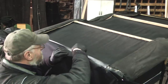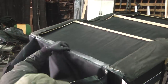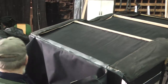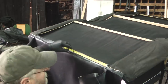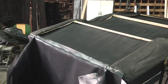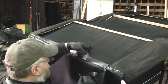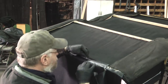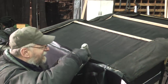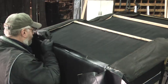With the curtain in position I'm going to roll the top back, kind of open up where I had some of this adhesive on there, get it down to the stitching, and attach this curtain a little more permanently. I'm going to go back to the same measurement where I want the straps to be and fish them inside so that they're inside the curtain. I'm going to put one staple in each one, then double-check inside to make sure they're hanging straight before I come back and put the staples in more permanently.